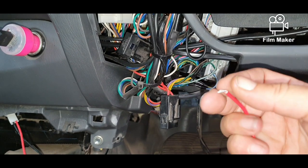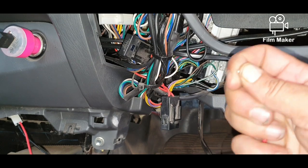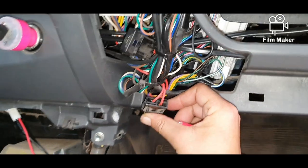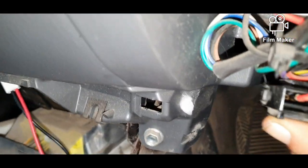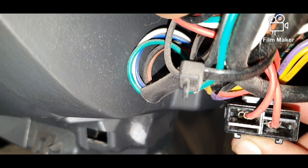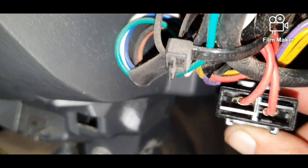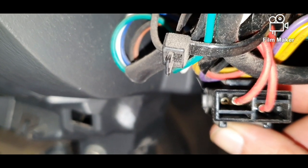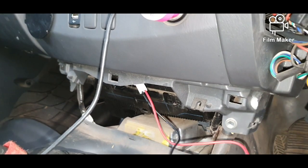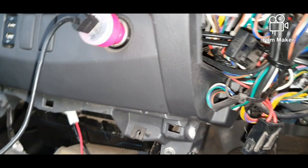So I'm going to fold that over. Okay, I'm going to fold the wire over, the strip wire. And all I'm going to do is feed it down. When you look inside a fuse plug, next to the red wire there, you'll see the other loop of the crimp that holds it in place. So I'm going to feed this into that other loop and create my positive connection.